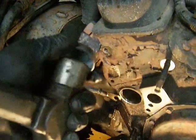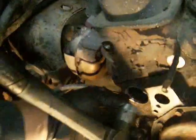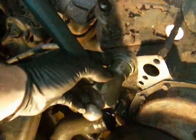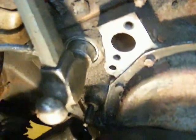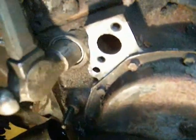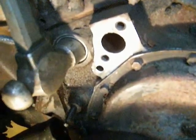I wish I had a tripod with me this morning so you guys could see this done. I'm going to install a new frost plug using two hammers. There's all kinds of ways to do this, but this way I like — hold one hammer straight and hit it with the other on the end to drive it in. Don't drive it in too far. You can control which side you put pressure on to make it go straight by moving your hammer around. This works here, but it might not work in another spot where you can't get at it, so there are other ways to put these in. Now I'll reassemble that side.